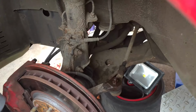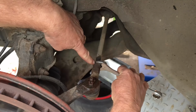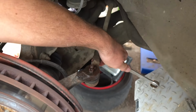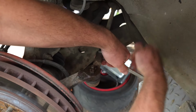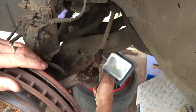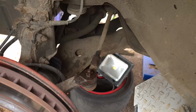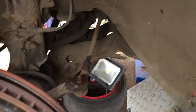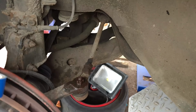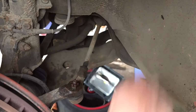Next thing we're going to loosen off before we try taking this apart too much is this nut here. Now all we've got to do is loosen it, because this is a locking nut that stops this ball joint swinging round, and they're normally done up really, really tight. That one wasn't. So once you've loosened it off, I'm then going to tighten it back up. I only wanted to loosen it first of all, just so it's ready to go when we are ready to take off the ball joint. Oh, hold on. This rod was turning with the nut, so have you not loosened it from this end? Yeah, it loosened from the ball joint, which is what I wanted. I'll just try it one more time. It's only so it's unlocked from the ball joint, you see?